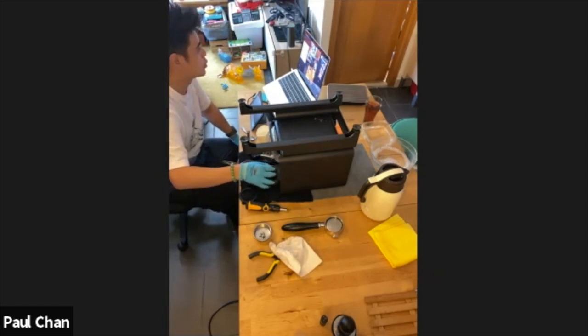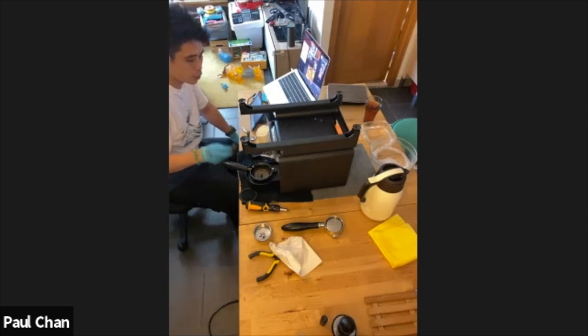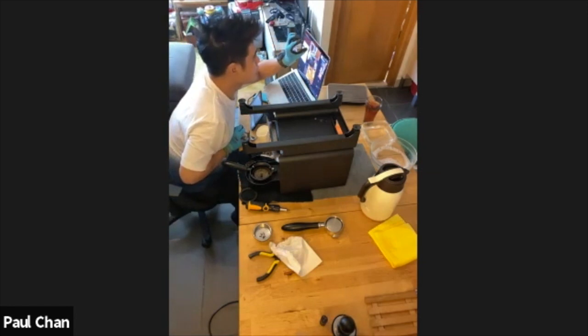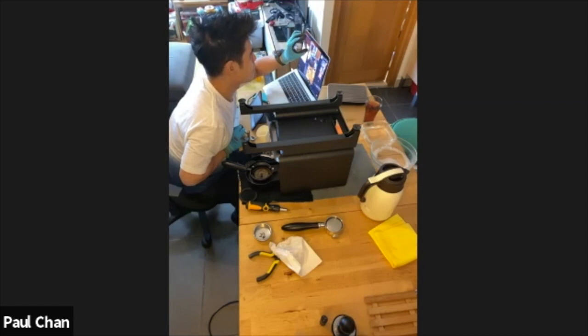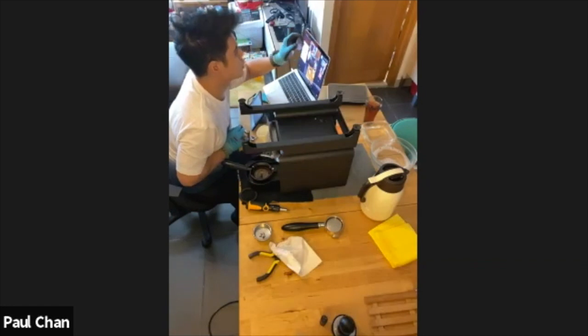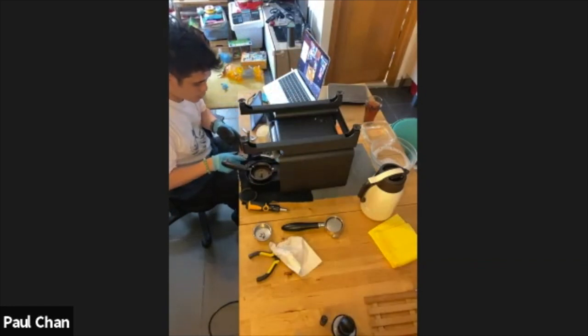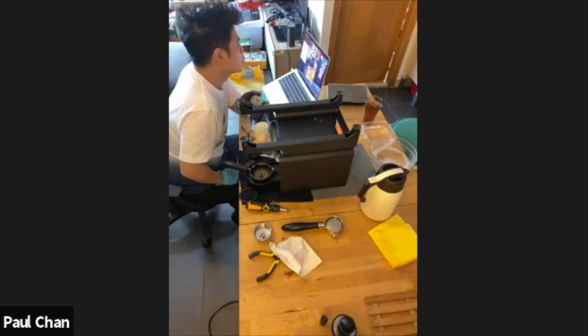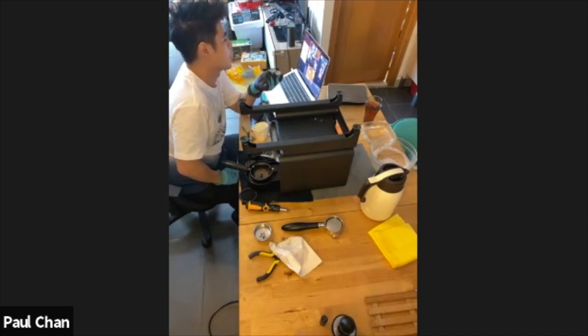implement that schedule into your DE1, and I find that after about 200-300 shots, your brass and your dispersion screens will have a buildup of coffee. Okay. Yeah. So if you see here, you can see the black here. This is after 1 week, maybe 3 to 4 shots a day at home. I think maybe more yesterday, but around 3 to 4 shots a day within a week will create something like this. If you're using darker coffee, it will happen a lot quicker. Darker coffee has a lot more oils. Lighter coffees won't do it as quickly, but it will still generate this mess. So around 200, 300 coffees, that's when you should start to think, oh, I need to clean my internals.